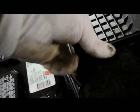And the way you take the rest of the box out is down here. You'll see a screw down there. It looks like about a 12 millimeter. And in the back over here, we see another 12 millimeter. So we're going to take those out, and then we're going to remove the rest of the air filter box.